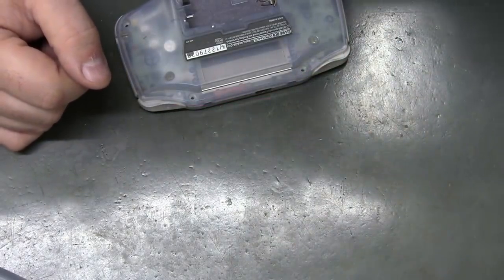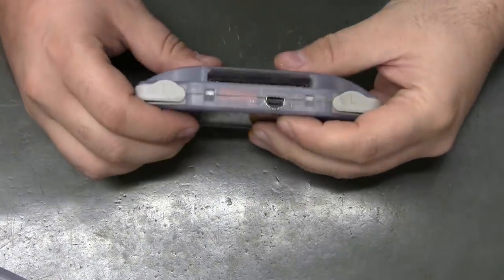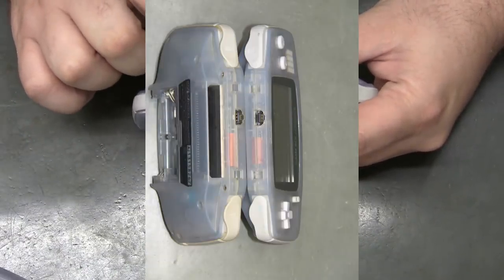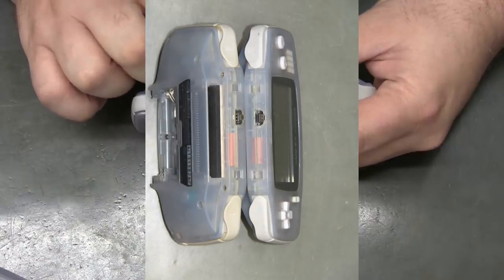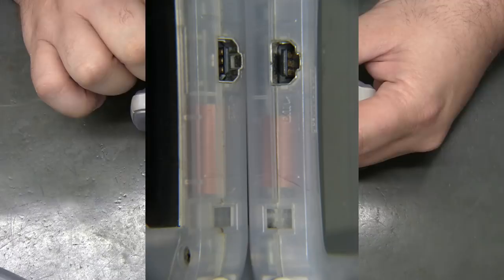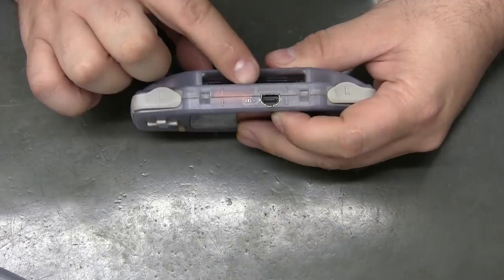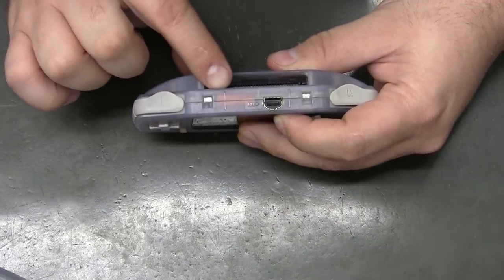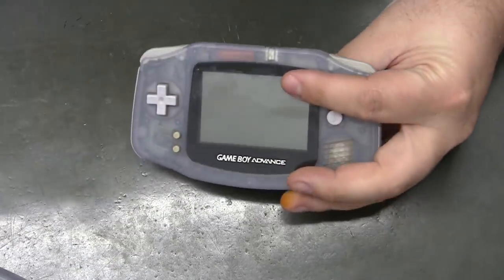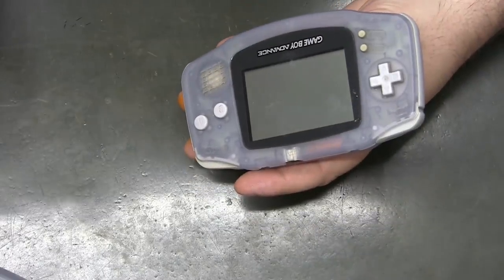I think I've got all 40 pins in front of me. And I've got a picture showing a 32 pin, and it's almost just as wide as those nubs, but it's not wider. And you can see this one clearly has at least 3-4 signal traces on each side of those nubs. So if you've got a 32, get a 32 pin adapter.